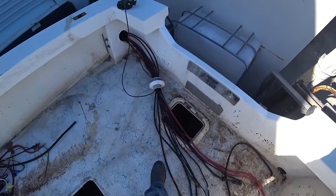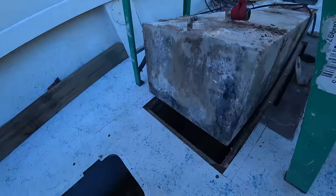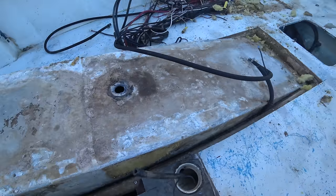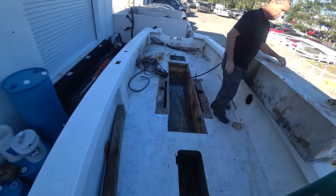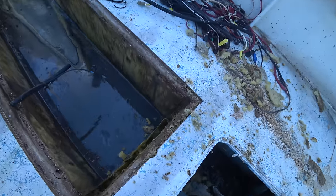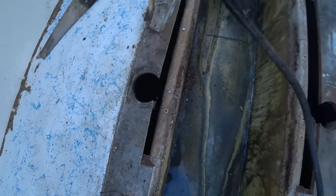A lot of work needs to be done. Alright, so we started getting the tank up — basically a homemade little jig here. You can see that it's sitting down in a foam bed that we're gonna have to clean out. This tank is pretty bad off. It's eroded everywhere. As you can see, that's all fuel leaking into the inside of the hull. Now we're gonna have to go ahead and clean all this foam out and figure out why the hull isn't draining over here and over there.